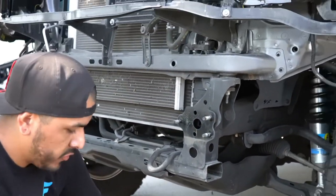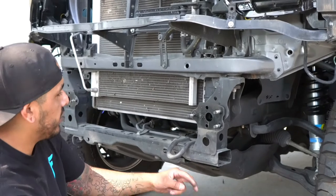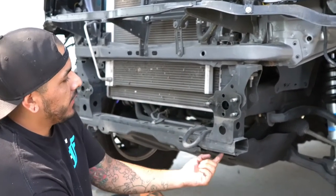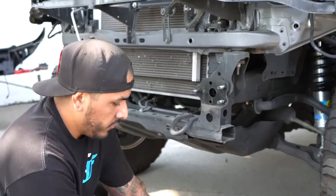Using the hardware that comes with the bumper, there's a new bolt that goes through here and that will actually level the bumper out. You use that to suck the bumper up, and then get a nut through the inside and the bolt through the bottom.